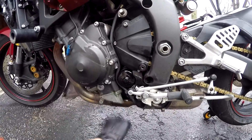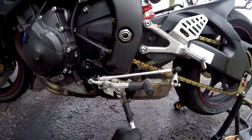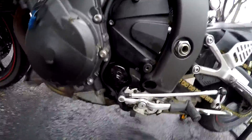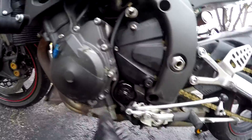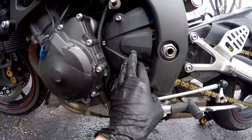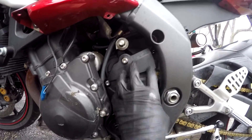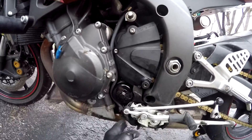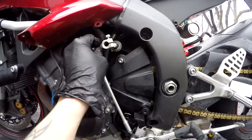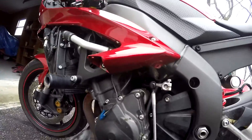I've got the oil filter installed. This little piece here is actually the sensor for the kickstand — it tells if the kickstand is up or down and will cut the engine if it doesn't sense the stand is up. I've got all the tubes rerouted, these have all been cleaned. That chain guide and cover are all back together. All I have to do now is reconnect this little shift arm, then put the under fairings on, then the mid fairing, and pull it into the garage.